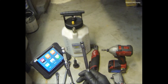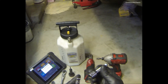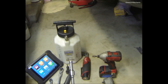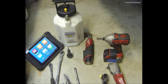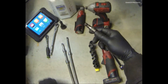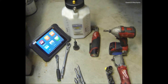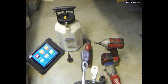I'd like to talk about these extensions called wobblies. There are two kinds: there's this type where it's a two-step wobbly — it wobbles initially but if you push on it, it becomes solid. I use these occasionally, but if you have a bolt or nut where you have to push on it, the wobbly turns solid and you're off. So I primarily went with true wobblies — I use these almost every job because you're hardly ever straight on a nut or bolt. They're both useful but I primarily prefer the straight-up wobblies.